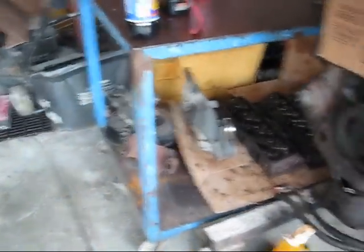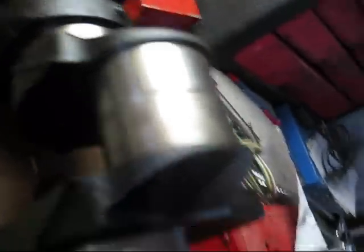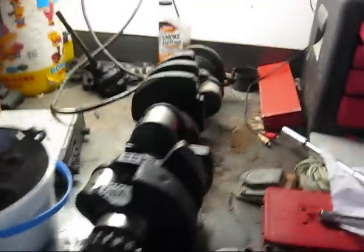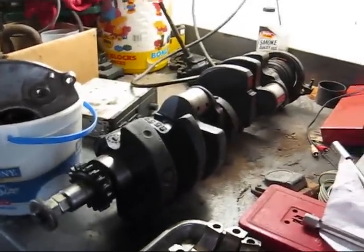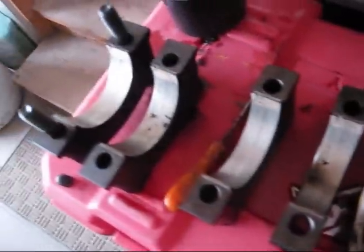There's a block for the engine of the 94, pistons and rods, push rods, heads and intake. Here are the rod caps and bearings out of the 94 and the crank. One of the bearings was bad — you can see how far it's gone down the crankshaft. I think the crank is junk. I'm either going to buy a used engine or take the crank out of the engine out back and get new bearings. And here are the main bearings and caps.